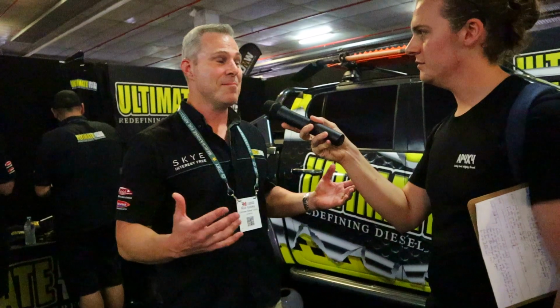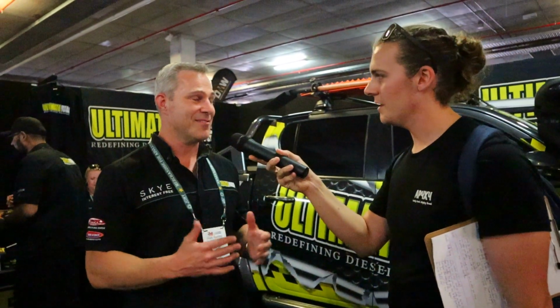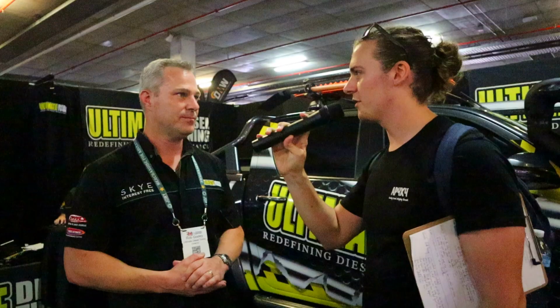Now, what's causing that? Maybe, obviously, the intercooler effectiveness on some cars is not where it should be, and in different makes and models they're blocked. We see those problems. We see boost leaks. Boost leaks cause less boost, more fuel, heat. These are all the things that cause problems. So those fuel to air ratios, AFRs, we need to have them in the right spot, where we want to see them.